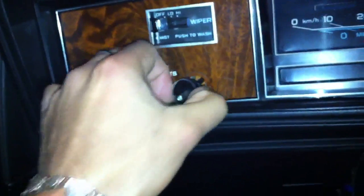To remove this light switch knob, it can sometimes give you trouble. What you're going to do is — if you can see this spot right here — it has a clip. So you put something sharp in there and pull it towards you; the clip makes it go loose. There you go, it's that simple. If you just try to pull it, it won't come out — that's the only way to do it.